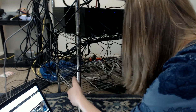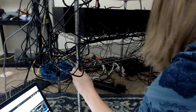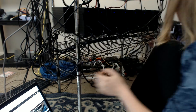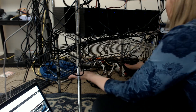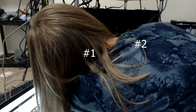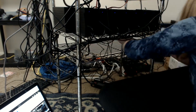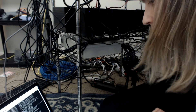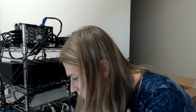When I was sizing up the rack and figuring out the organization, I realized my original plan of putting the power supply underneath the hard drive rack wasn't going to work — it's a little too long. So I've made a new plan: I moved the lower rack up and I'm going to mount the power supplies on a shelf — one here and one over there — allowing me to power 32 drives from this rack. I'll need to buy another rack kit to add one more row of drives below the PSU. Because of USB cable lengths, I might have to shift rows around, but I'll save that for later.